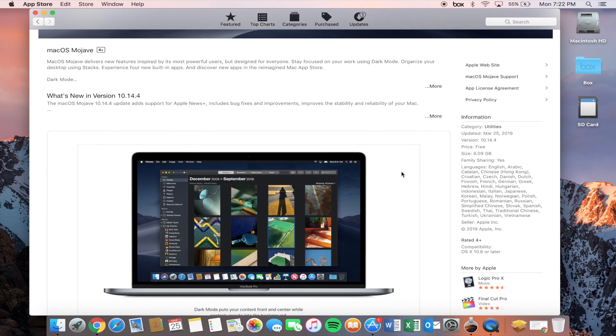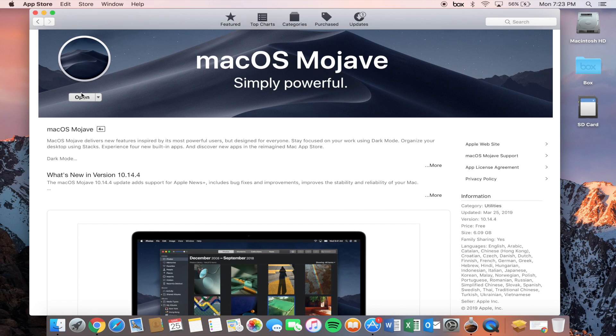You're going to need a USB drive or an SD card that is at least 8 gigabytes in size, because the installer is just over 6 gigabytes and you want enough storage. Make sure if you have anything on that USB drive, it's backed up accordingly. Speaking of backups, before proceeding you should back up all documents, photos, and everything on your computer onto a portable hard drive or the cloud, because the clean install process is going to erase everything off your hard drive.